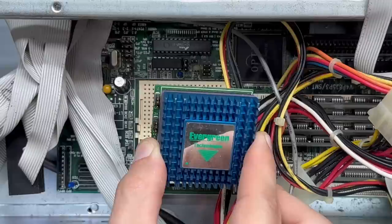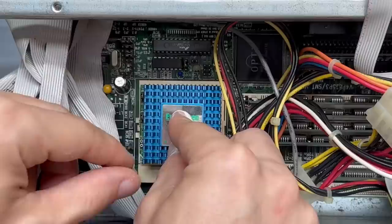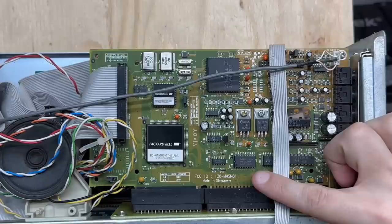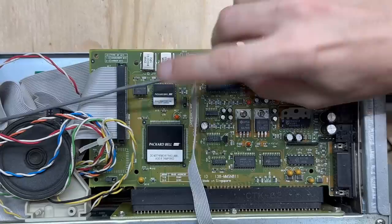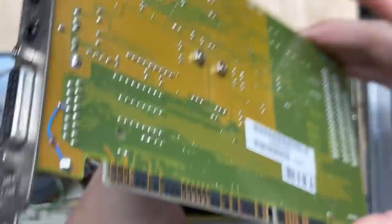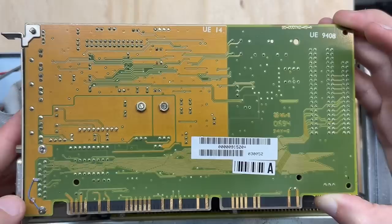If I had to guess, it's probably a 586 upgrade. And that sound card seems to suggest that this is some kind of Franken-system, clearly harvested from a Packard Bell. Sure looks like an Aztec card to me, and hiding behind that cable, got an OPL3 chip. Awesome, this system's full of treasures. Let's go ahead and liberate this sound card. Here's a closer look at it - back side's pretty clean, just need to do some gentle cleaning on that edge connector. I wonder what's going on with this bodge wire here - that sure looks like a factory bodge.